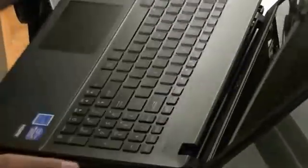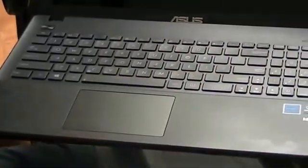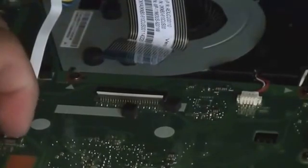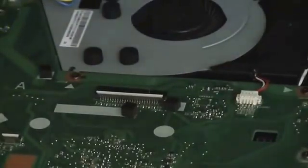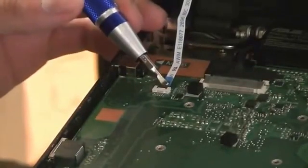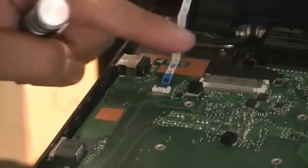What you're going to do is take your flathead screwdriver and lift this guy up ever so gently. There's going to be a white tab right there — you can kind of see it. You're going to lift up towards you; you can use your finger if you want. All you're going to do is pull it right out. Same thing with this white clip here — make sure you don't have any static — pull up and then pull up, and then it came right off. There's one more on the corner here. This one has a gray top instead of a white top, so you're just going to take your lift up — kind of see it raised right there — and then pull. Now it's disengaged.